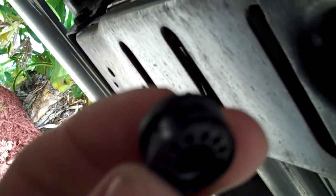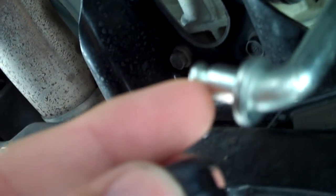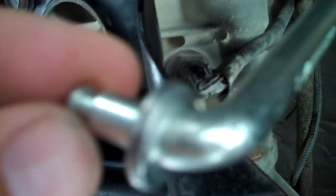Bushing orientation - I just had to take this one out. There's a small hole and then there's a large hole - didn't notice it until just now. The beveled side has the small hole and both are going to push in toward the transfer case unit. I called my mechanic and he says there's supposed to be a c-clip on there, but this bushing is what holds it. If they had pushed it through further and put an e-clip on it, that would have been perfect and it wouldn't have fallen off.